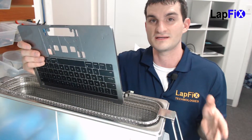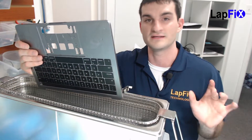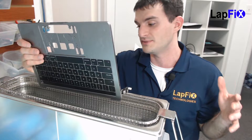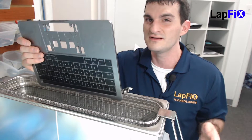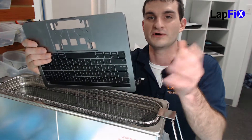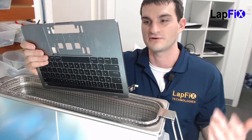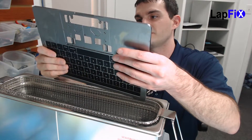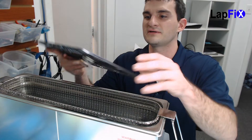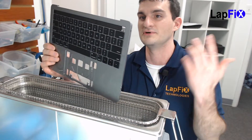We're doing it at a lot lower temperature than normal. Normally for boards you do it around 60-65°C. We're going to hit it a bit lower than that — about 40-45°C — because we are a little bit concerned about the plastic here, and it's not quite like a board in how it can take all that heat. But we definitely want to make sure we get all underneath here and all under the keyboard.